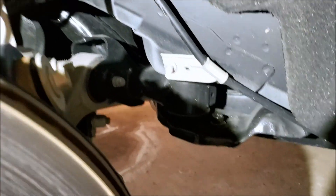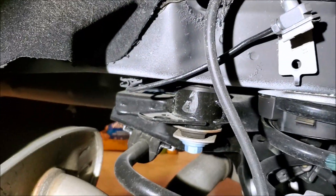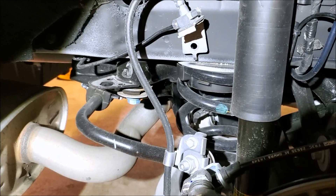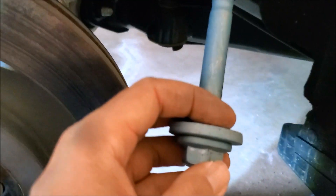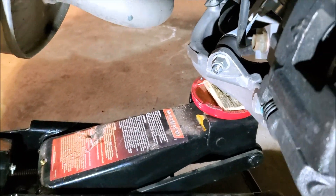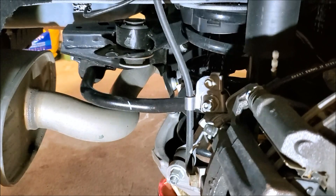The brake line bracket is 13mm. The bolts up top are 18mm. Come down here — you've got two bolts that are 13mm as well. Then go for your big ones, which are 21mm — you'll probably need a breaker bar because they're in there pretty tight. Before you remove those, get your jack ready underneath, because as the subframe comes out it's going to drop and you don't want the whole thing slamming down.